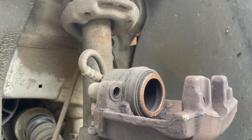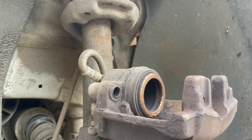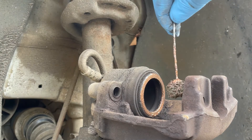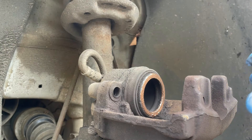The next thing is to run copper slip around the contact face on the piston — this is my personal preference as it gives a clean contact and acts as a corrosion inhibitor between the back of the brake pad and the piston. Then take the copper slip and give a neat coating over the two fingers on the caliper. This ensures a really clean contact with the outer and inner brake pad, while the brake pad itself doesn't appear visibly coated in grease — it looks clean and professional.